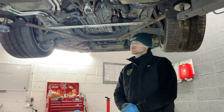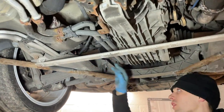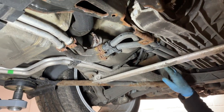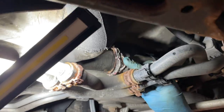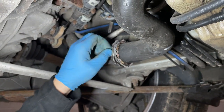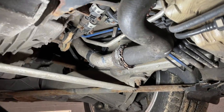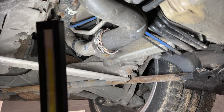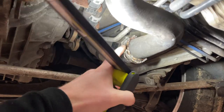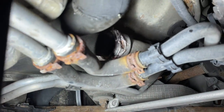Show the two pipes that the engine's got to be dropped for because they're corroded and they need replacing. So the two over-engine pipes are just up here, running down the other side of the engine, down the body here. They suffer the worst at this point, as you can see - they just start crumbling away and then eventually start leaking. They're very similar to the front crossover pipes - it's just a poor connection design. The ends start corroding, they start splitting, then they'll start leaking. You can see the pink staining on there - that's signs of coolant getting out and evaporating on the pipe and leaving those stains.